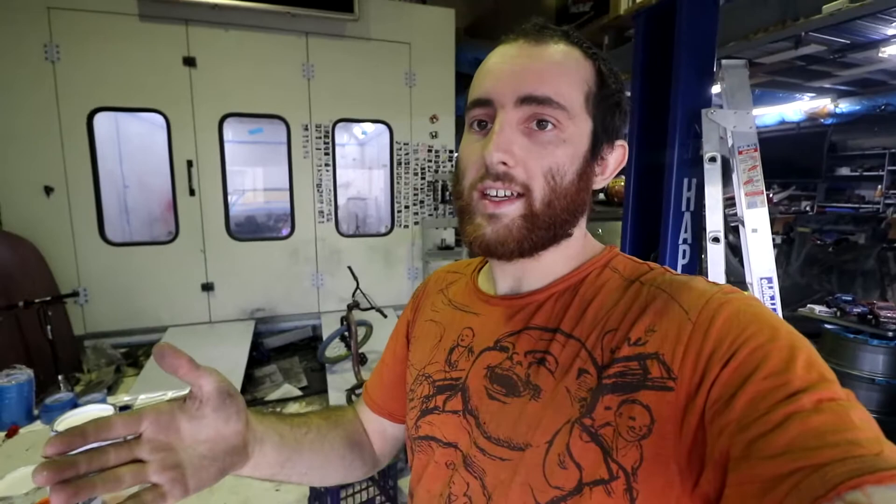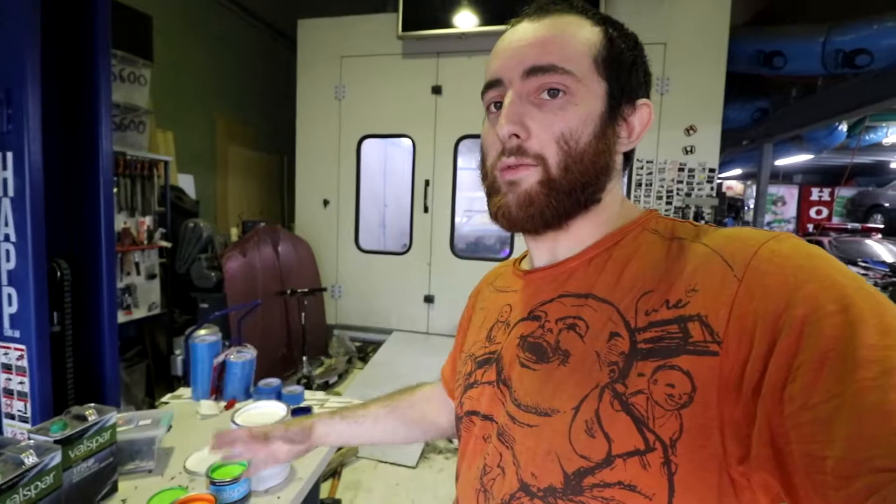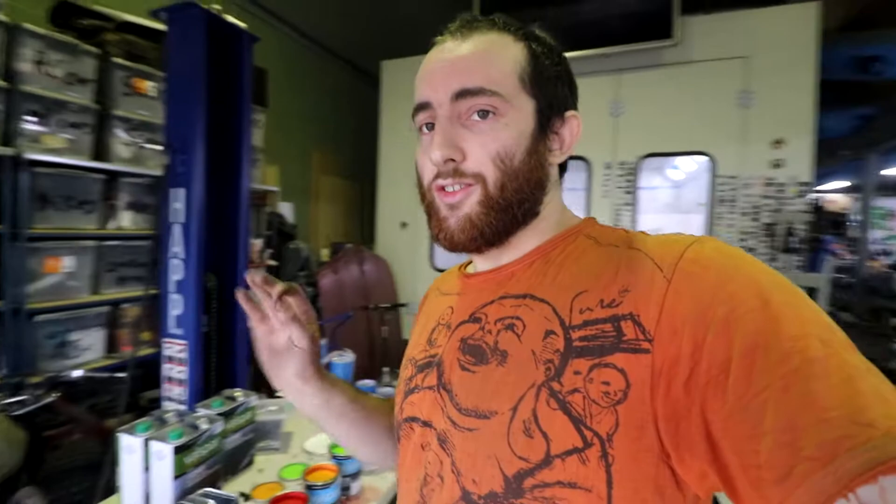Because there's blue exposed, the time from the first blue coat to the last red coat has to not be longer than the full drying time, otherwise the red won't stick — or the clear won't stick to the blue, or the clear won't stick to any of it. I've got to spray blue, white, green, orange, red — those could be in any order because they don't actually go on top of each other. And then clear coat. I really hope I get it right, because there's a fair chunk of money in the paint and a lot of work going into the car.